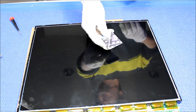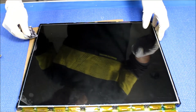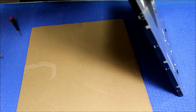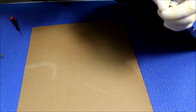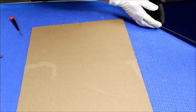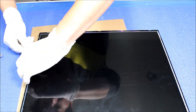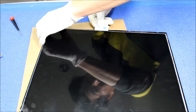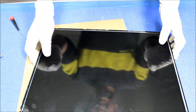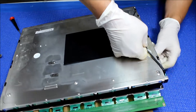Use this tool — stub your corner. Do not use any metal parts. Kind of lean forward and let the glass drop a little bit. As long as you get in between, you kind of do a little like this — slice over, just slowly, no rush. There's a little bit of glue. Now it's loosened up. Flick over, pull the wire. Now it's out.